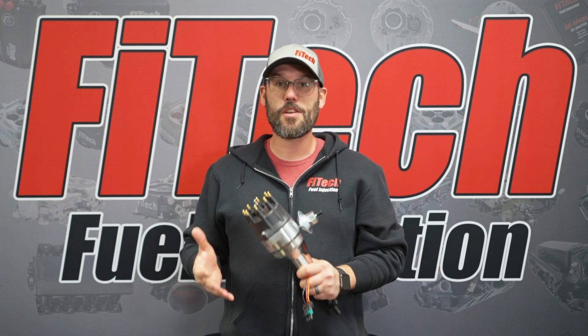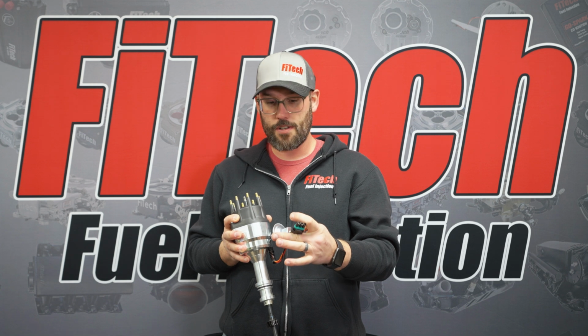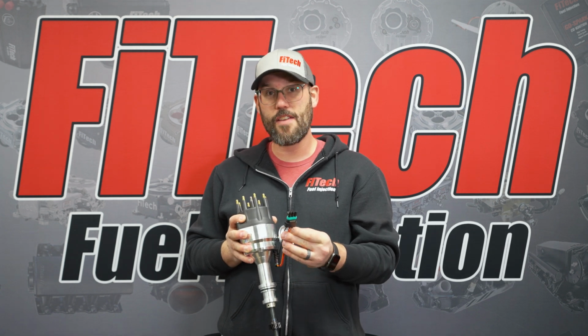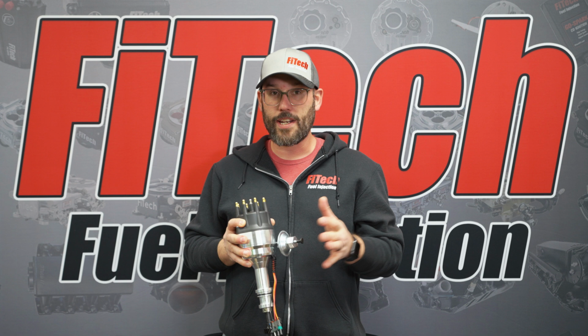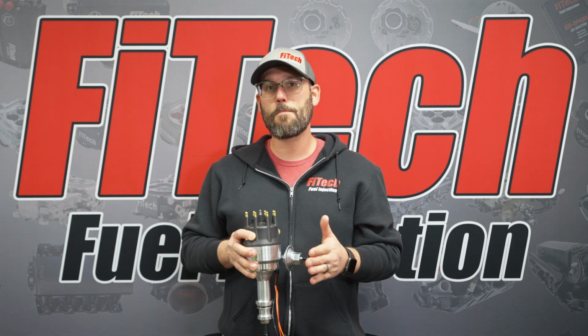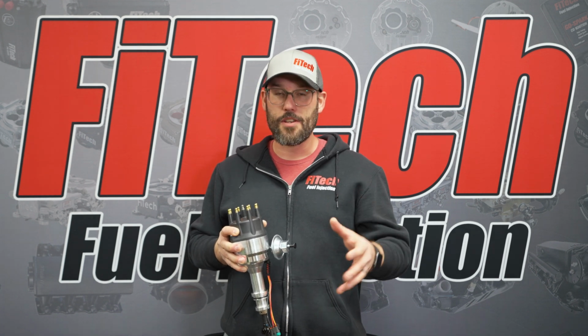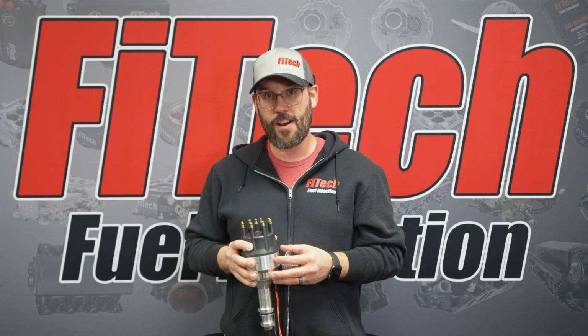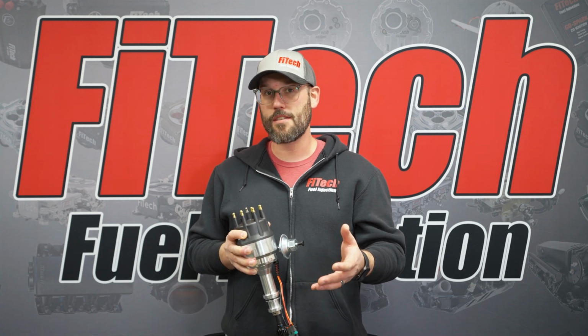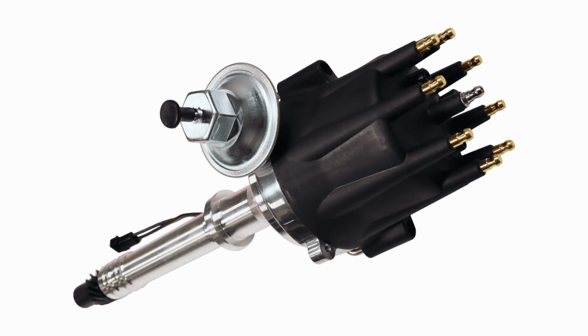This distributor will utilize a remote mount coil, so the three connections are a ground, a hookup to the positive side, and the negative side of the coil. When getting a TAC signal from a ready-to-run distributor to the EFI, you're going to pull that off of the negative side of the coil. So with that said, this will work with your throttle body EFI systems, your Ultra RAM systems, as well as the 6-pack systems. Last, we have our two-wire distributor.